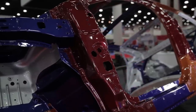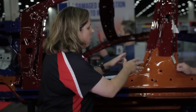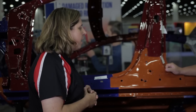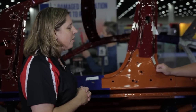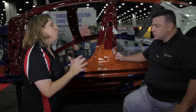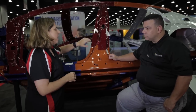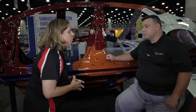You can see many areas have no weld bonding material — when you replace it, you have to weld-bond it. You have to plan things properly with these advanced structured vehicles. This car is a great example as you look at different steels and where they are, because when cars come into the shop they're all painted the same color and look the same. This lets us know how the car is designed to protect the occupant and move energy around — making repair vs. replace more than economics, but a question of safety. Let's talk about how we join these different steels together.